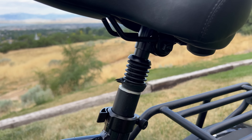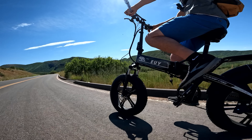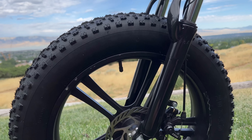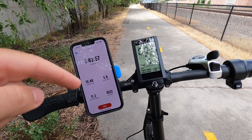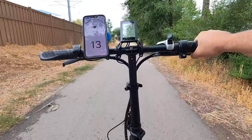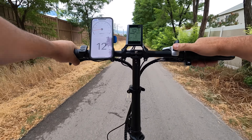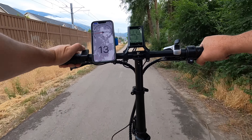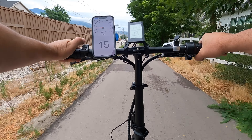Down to 50% and I've gone 12.63 miles. Diving into the cockpit: you've got a 23-inch span on the handlebars with wing-tipped hard plastic grips — they don't move and they're not that comfortable. Got a 7-speed Shimano shifter; going up is one at a time, coming down I can go from 7 to 1. The saddle is about average for comfort, but there's a seat post suspension with about 2–3 inches of travel, which works well. You've got 20 by 4-inch all-terrain tires and a front fork spring suspension, which is okay.